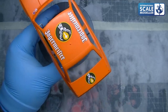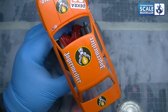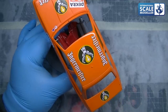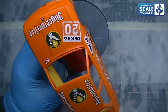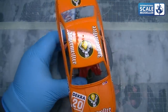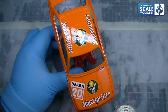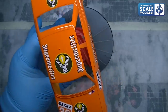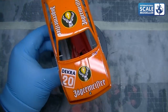Use the light to your advantage — I've got a decent LED light in the spray booth now. Angle the body towards the light so you can see the reflectiveness of the wet coat as it goes down; you can also see any flaws, dust or what have you. We're not trying to get a wet coat — we're literally putting a semi-wet tack coat down. I work methodically all around the car. The body is on the Tamiya stand as usual, taped inside as well. This is a newer stand — I've had to use some insulation tape as the prongs like to pop out; it's wrapped with insulation tape inside and masking tape where the prongs sit.